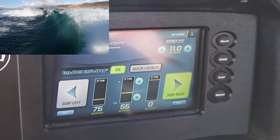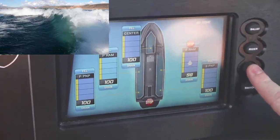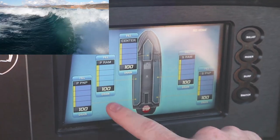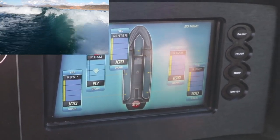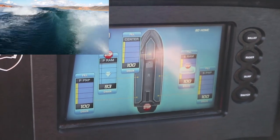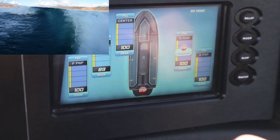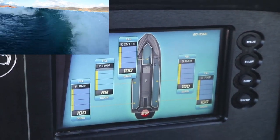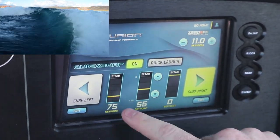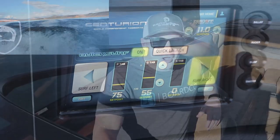We're going to show you how you can use this feature to eliminate any kind of wash or rippling that you get on the top of the wave and truly get the best surf wave possible. We're up and going — we have the boat evenly weighted currently and we're going to remove a little bit of weight out of the side that we're not surfing on. You do that by pressing the ballast button and simply pressing drain on the off side — in this case the port side that we're not surfing on. This is going to move a little bit of water out of that side and put a very slight lean on the boat. To exaggerate this even further you can press fill again on the side you're surfing on, which is going to cause the ballast to override and fill even further beyond 100 percent. On the counter side you can see we're down at 89 percent — the goal is to empty just enough weight out of the other side to where your wave becomes perfectly crystal clean.